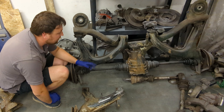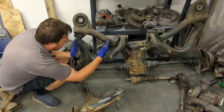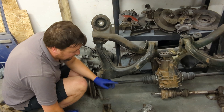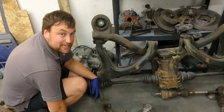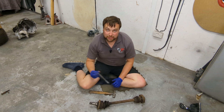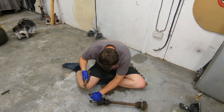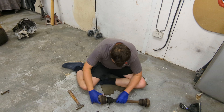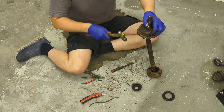If you haven't watched the first video, this is the standard axle and this is the modified one — I've made the arm smaller, pulled the whole lot in, and moved the bracket. That creates a problem with the drive shafts being too long. I'm going to take them apart and see what I can do. This is the original drive shaft I removed, which is in the worst condition, so I'm starting with this one. I'll knock the boot clips off with a hammer and chisel, then slice the boots with a utility knife to see inside.